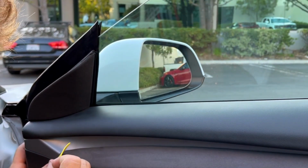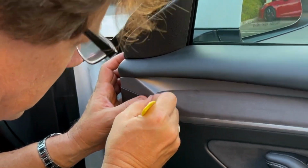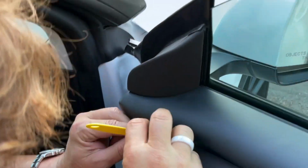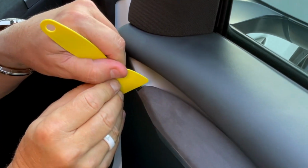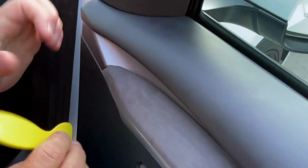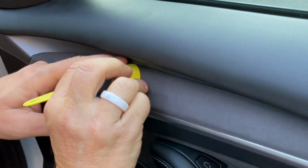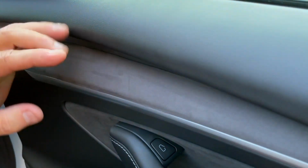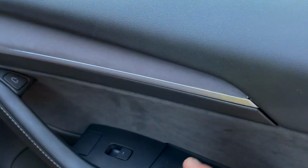Now we're going to tuck this in. We're going to use this little edge here, and tuck it right in, just like that. We'll keep putting it like this, pushing down into the crack, filling it up as best we can. Then again, over the top, I'm curving the squeegee like this. Go around, pushing down. Lots of pressure, because you want to get pressure on it, and you want to make sure you have no white showing. See right here, low, low angle. You want to make sure you have no white or wood showing.